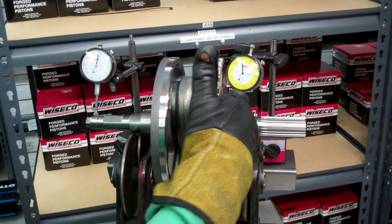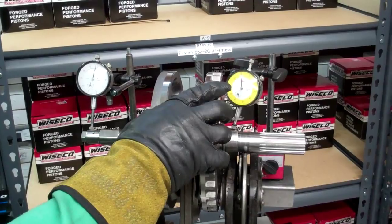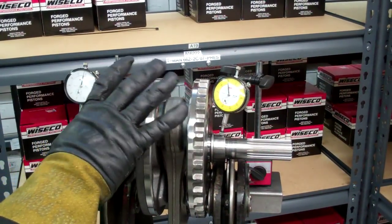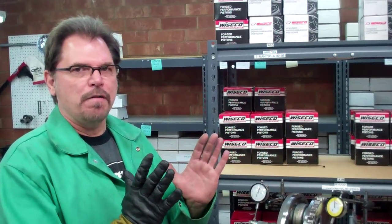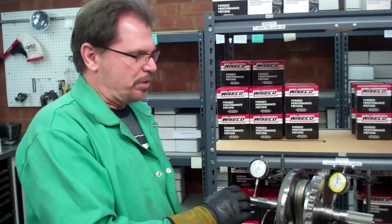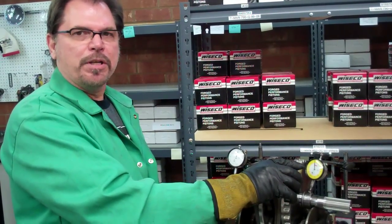What we do is focus on these two areas because those are the areas that are supported in the crank cases. If you try to true this thing perfectly at the end, you're just manipulating this crankshaft. After it's been in the case and it's run and been RPM'd, it will always go back. You're better to let this run out two or three thousandths and let this be non-manipulated before you weld it.